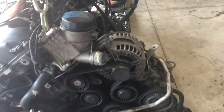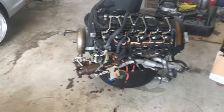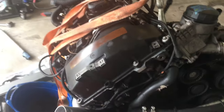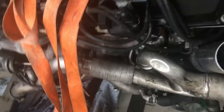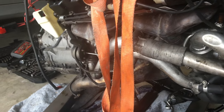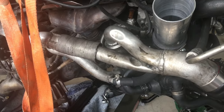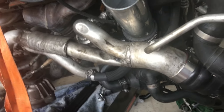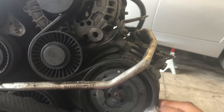The only thing I'm really taking off this motor is just the alternator since that's brand new. I would take the high-pressure fuel pump, but this one seems like it was already changed, so I might as well have a spare one sitting just in case. I'm going to take the RB turbos — I don't think I want to roll with stock turbos for now, so at least have some power on there. Down pipes, that's a given. Then switch over the inlet pipes. My water pump and thermostat are also going over there, since that's the reason I got the other block — because I needed a water pump and thermostat, and mine are fairly new.